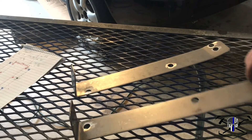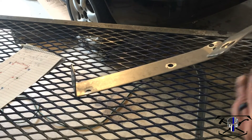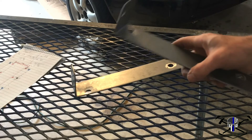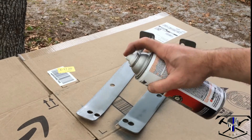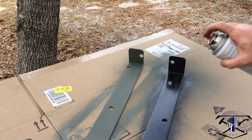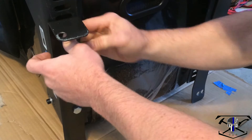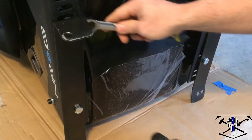Got both of these bent up the way I needed to. I also forgot to mention I did have to make a second slight bend on here — maybe a 10-degree bend — just to meet the contour of the floor. So now we can throw a quick coat of paint on these and see if we can get them in the car. Now we can just bolt our seat rails to the actual seat brackets themselves. Tighten them down and we can go have a test fit.